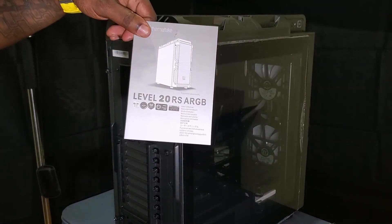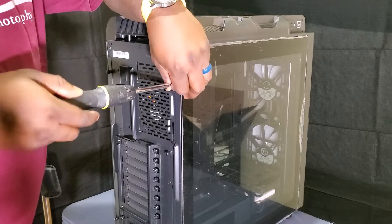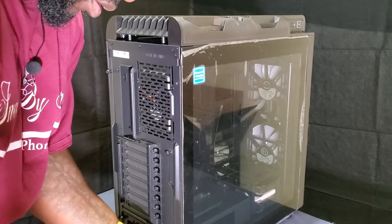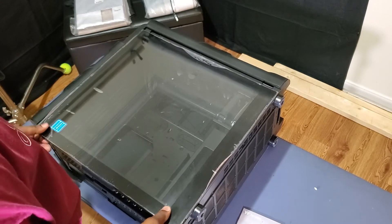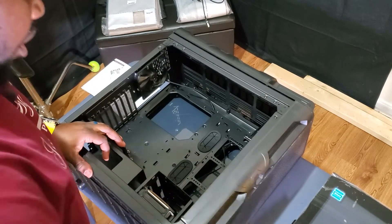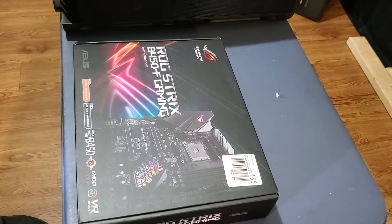You can also see the motherboard slot, cooling fan, multiple ports for graphics cards, and at the very bottom the power supply. Guys, don't forget if you're doing your first build, always use the manual. I'm going to use a multi-purpose screwdriver. Once you untighten the screws you can take them off by hand, and once you've got the screws out this part just slides right off. This slot right here is your hard drive slot — go ahead and take those out because you've got some extra pieces you need to use. Your bag of goodies — do not discard.